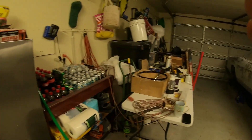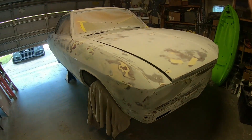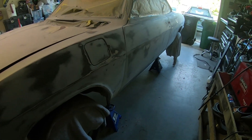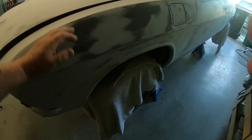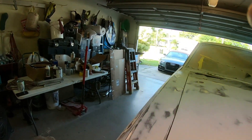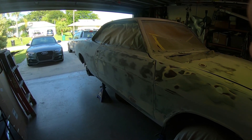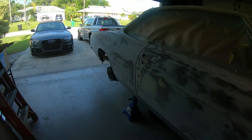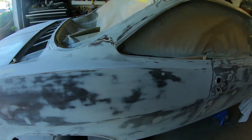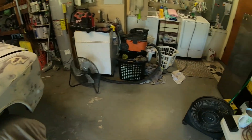Alright, back at it — Sunday morning, 8:30 AM. Just getting out here. Got to complete the sanding today, gotta fill in all the low spots I showed you guys on yesterday's clip. She's looking pretty straight now. Still a little bit of stuff at the bottoms to do, under here. Sand the back, and then we're gonna try to get another coat of primer on it today. I'd like to get the headlight switch in also, maybe the steering wheel, but I want to get all the priming done while everything is papered. So I gotta wait a little bit before I start up the compressor — it's still a little early — so maybe I'll just do some hand sanding for now, get these small spots that I have to hit.